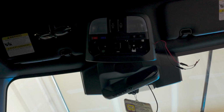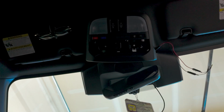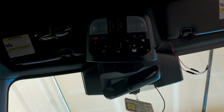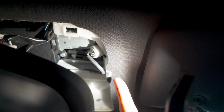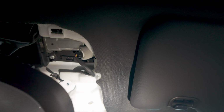Okay, so all I've done is just tuck these wires through here up to the top, and now all we need to do is connect the wiretap. Okay, false alarm, guys. This black wire right here is tucked up in a way, and this is what he used in his post. So, yeah, you have to pull it down. And his color diagram also lines up. White goes to red, and brown goes to black. So, I am going to get that hooked in there now.